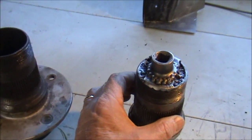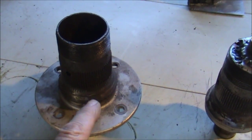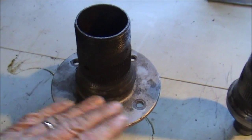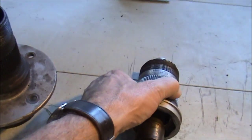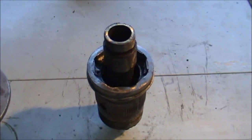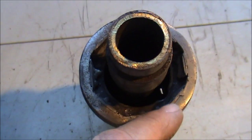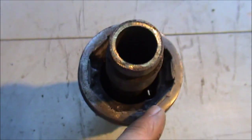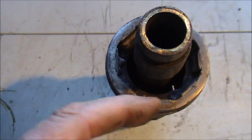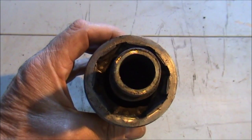And this is a tool that I made - excuse my welding here, I deliberately just piled that on to hold it - using one of these hubs as a basis. I discovered that if I cut through here and take this flange off, I end up with a circle which is about the same outer diameter as the nut on the back of the Healey. And then what I did was I welded in some sections here, some pieces of steel, just little flat bits of steel. I think I rounded them off slightly so that they would match the radius there. So I welded in eight of those and that gave me an octagonal socket.